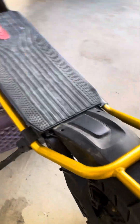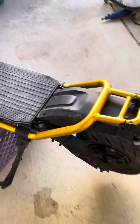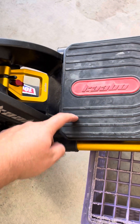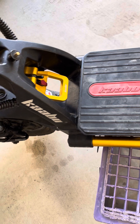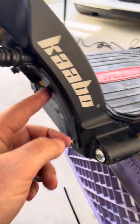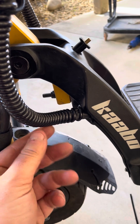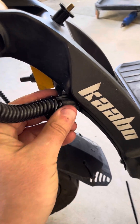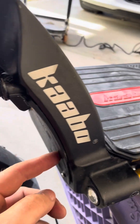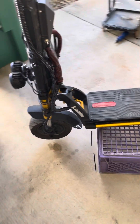The motor cable isn't the worst, but the brake cable is pretty tight. The routing under here is tricky — the brake cable comes on this side, comes around here, and goes that way. To create extra length, you take off the covers in this area. There's normally a bigger bend in the cable with some excess wire, so you can feed it through. Just unwind this little cover and feed more cable down into this area, then pull it from the other side. You need about two to three inches worth.